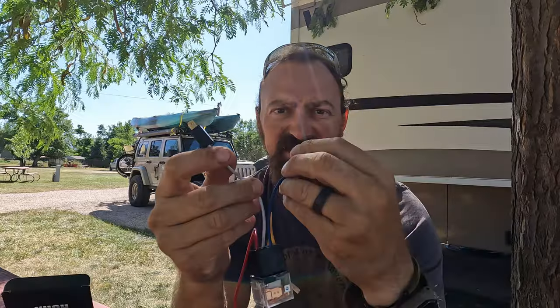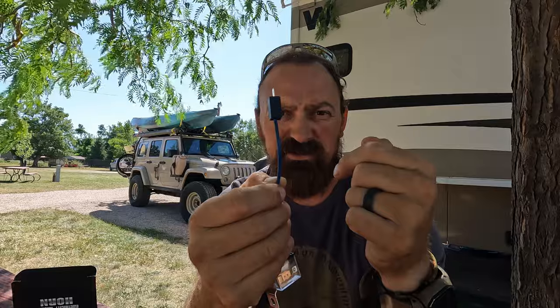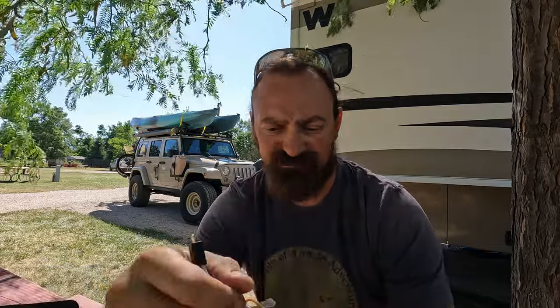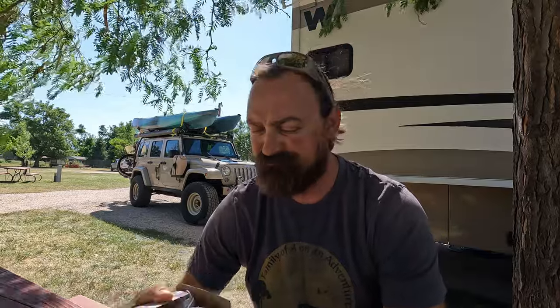So you're going to splice this in, and then you have your negative horn power that's going directly to your horn. The way ours is set up is it clips in, and then it's like a connector. So what we'll have to do is I'm going to have to cut that, and then put on a couple of female connectors, and then they'll be able to just slide right onto this. So it should be rather simple. The hard part being that I just have to run the length of wire all the way to my cranking battery. So that's about it.